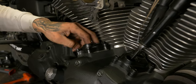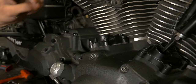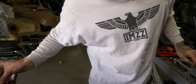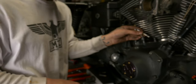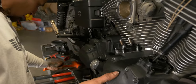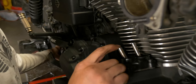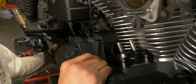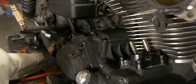Normally you could stick your fingers up in here and you can spin this over just like how we watched these two, and you can feel for the two when they're even, when this side's on overlap. But it's a lot easier, I feel like, to have something visual. So our machinist Jimmy made me a set of these old snipped off stock lowers, and they've both been machined down to equal length, so that way I can physically watch the cycle still. We have exhaust, intake. That's gonna be it right there.